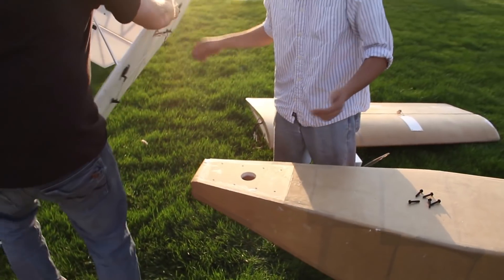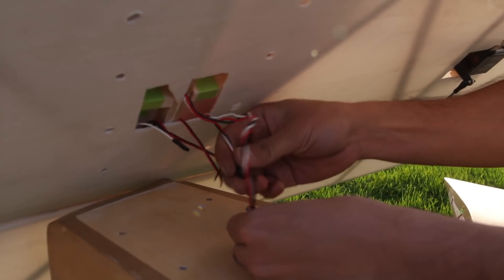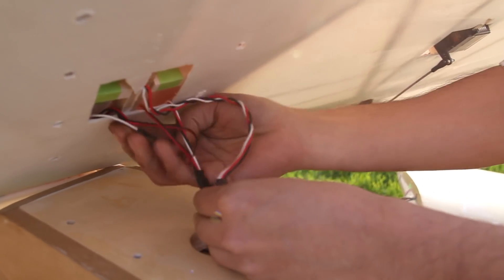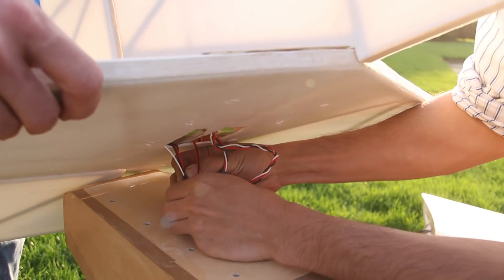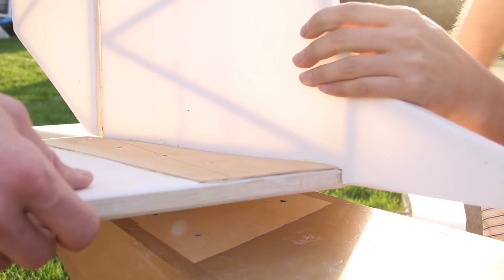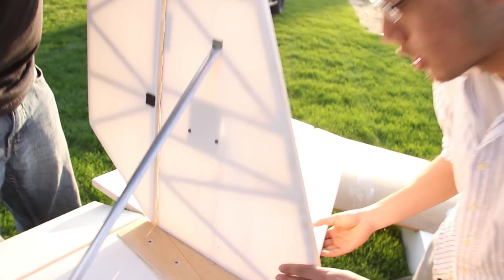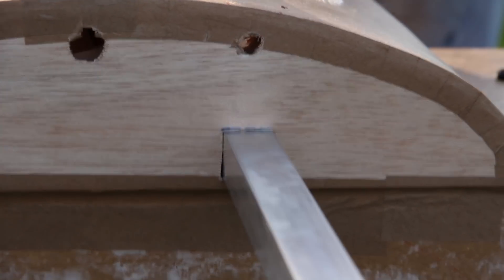It's a re-maiden because I have to test all these systems out before we take it anywhere. These are all silicone 20 AWG wire — handmade extensions — because I wanted to be sure there were as few failure points as possible. There's only one run of wire, not multiple extensions stuck together. More extensions mean more points of failure. I just don't trust a lot of the pre-made ones. If you ever have to use extensions, always tape them when they're internal inside your machine.